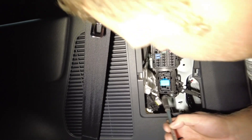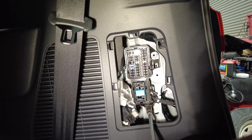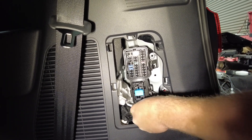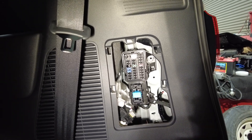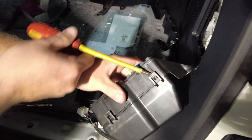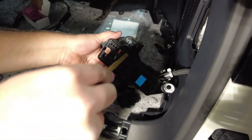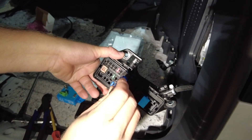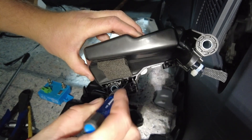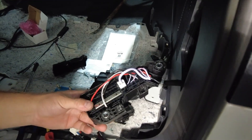First we're just going to take the fuse box off of its original mounting by undoing these two bolts. Keep these bolts aside so we can put it back together. Once you've got the fuse box out, unclip these tabs just like this with a screwdriver — three clips, also a locking tab with a smaller screwdriver. And then the cover comes off like so.